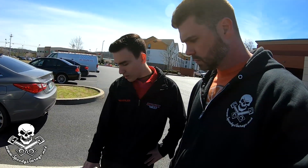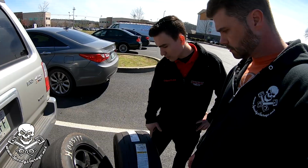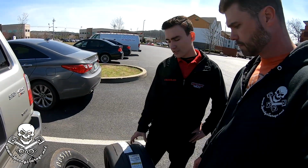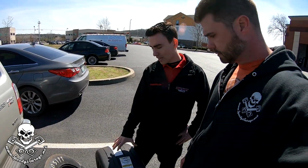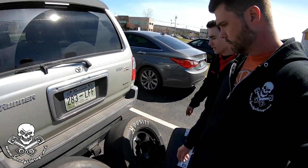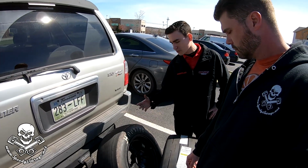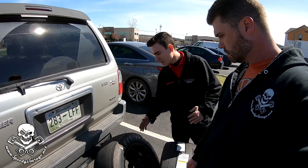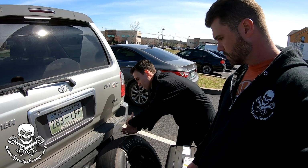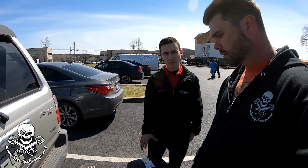Yeah, so from sidewall to sidewall on a radial tire, your belts are going to run directly horizontally across the tire. And so that's going to help keep your contact patch the same, and they don't follow the road as much. With a bias ply, on old school vehicles, this is the only tire they used to make, and Coker still makes them for your old school restorations, the cords are zigzagged across in a cross pattern. So it actually follows the path of the road as opposed to creating the turn.